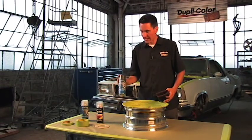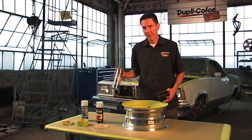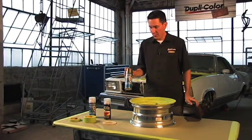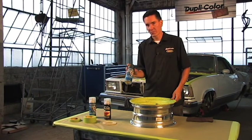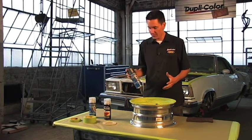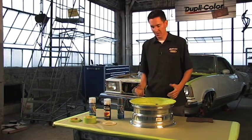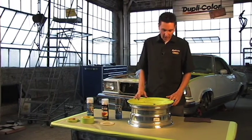This wheel coating will give it a matte finish — it's not a glossy finish. We do offer a clear coat for this line, and we are going to choose to clear coat it because we do want a glossy finish. This paint is an enamel, it's extremely hard, it holds up to road abrasion, and it holds up to all the chemicals that you use to clean these wheels and tires. With the clear coat, it gives it a real nice high gloss, you can polish it, and it'll hold up real nice.